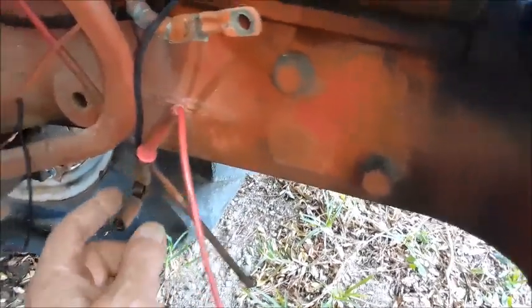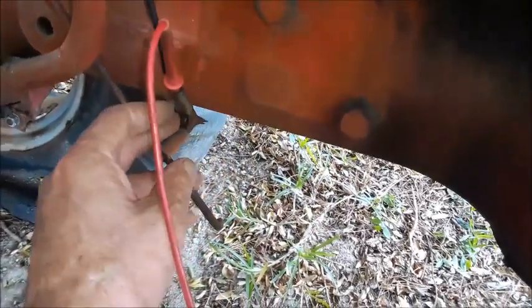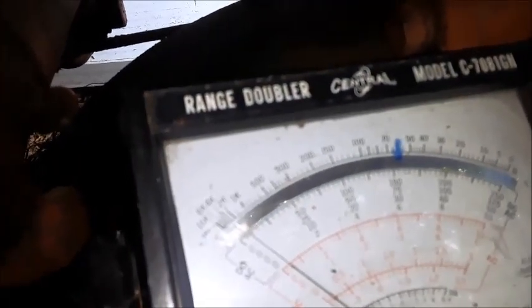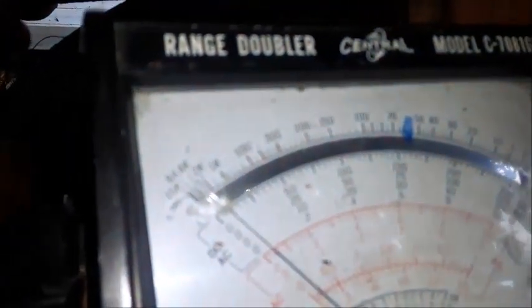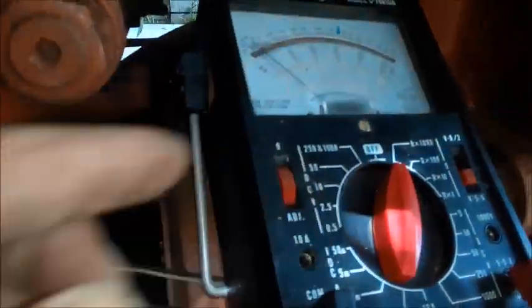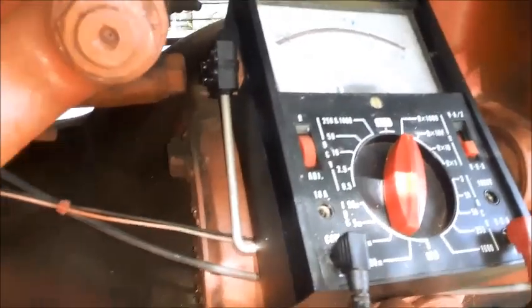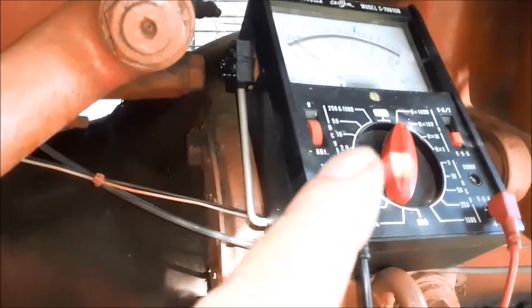You can see I've got my multimeter connected to the positive. It must not connect to the body somewhere — okay, that is plastic, it's fine. So previously, with the positive on the positive terminal and the negative to the body, there was no resistance. I'm tapping on the body now, and before that it was a dead short. So maybe I'm doing something right.